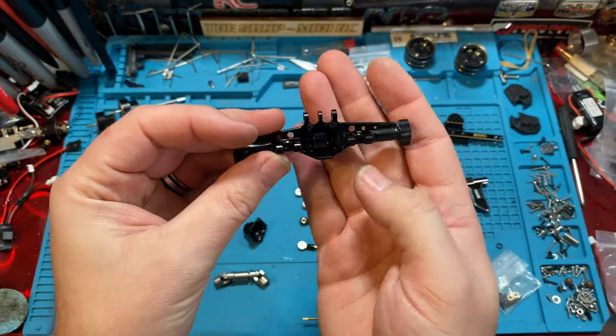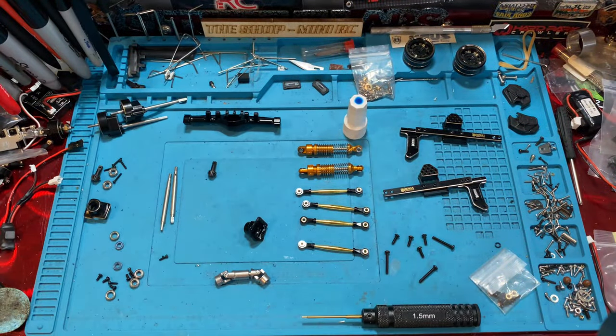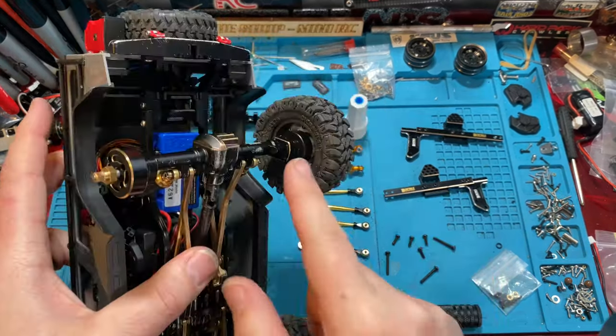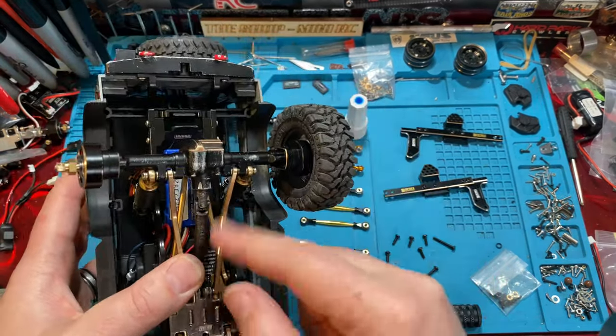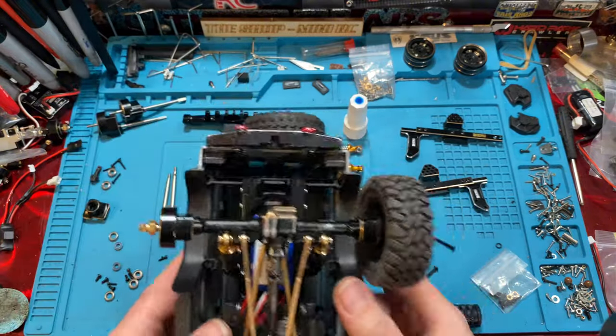So we'll go ahead and look at the axle and the ring and pinion next. We do have all of our links, shocks, and ball joints mounted up. We're good to go. We're going to take a look at our original truck here. Remember, we're on portals, so things move backwards. If we're spinning one direction, these are going to spin the other. Just keep that in mind, depending on if you're in portals or not.